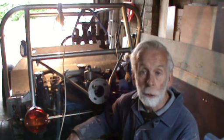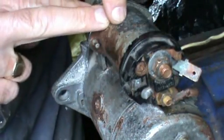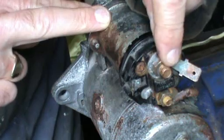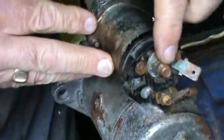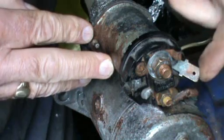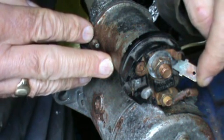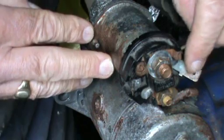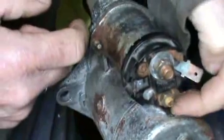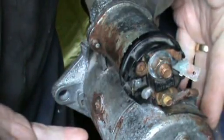So I'll show you how to do a bench test of a starter. I've taken the starter off the car — just to let you see the terminals: this is where the supply from the battery will come onto the solenoid, the solenoid being this part here. This terminal connects to the ignition switch on the dashboard, so when you turn the ignition key it sends a signal down this terminal into the solenoid to send current to the terminal that feeds the supply into the starter itself and turns it.